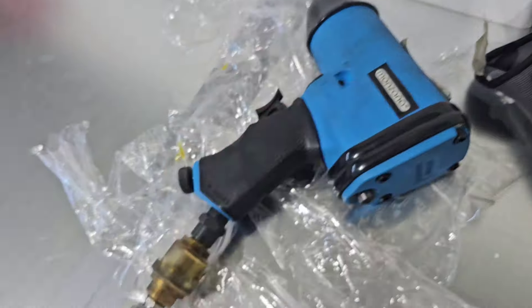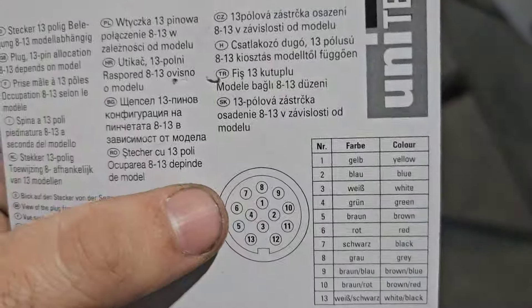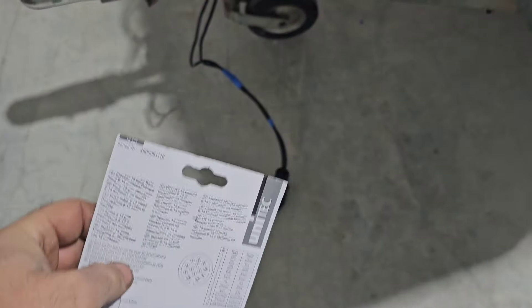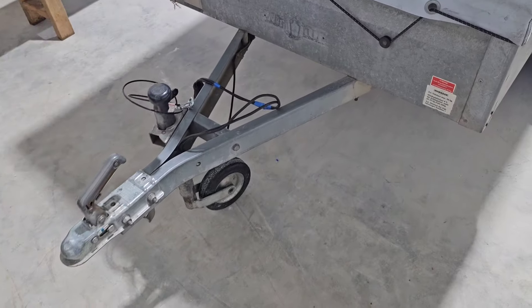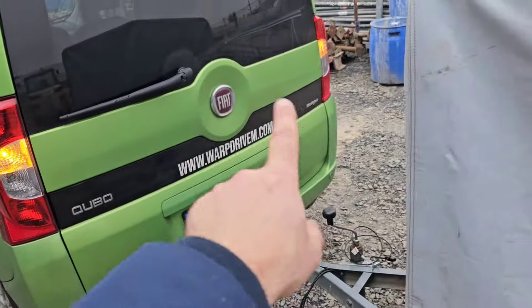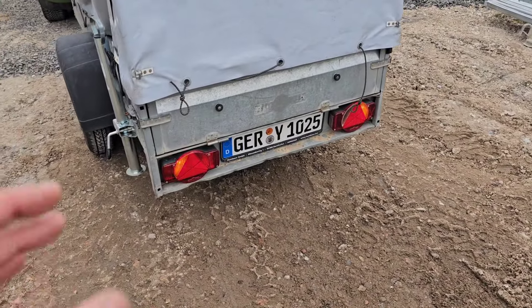The compressor is confirmed working — done. On the back of the trailer plug there's a wiring diagram and you can follow all the wires. If the colors don't match you have to check every wire against the diagram. In my case everything was the same color as shown. I put the new 13-pin plug in — done. We can take the trailer out. I installed the trailer to check if the plug is okay. We have the hazard lights — and it's working. Job done.